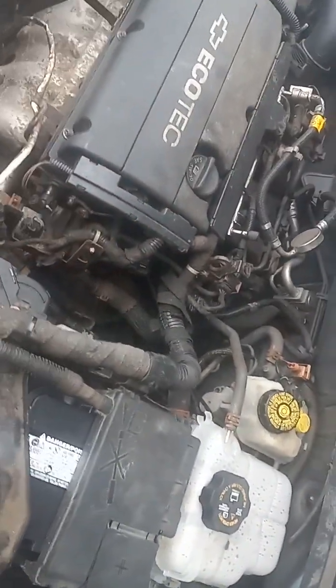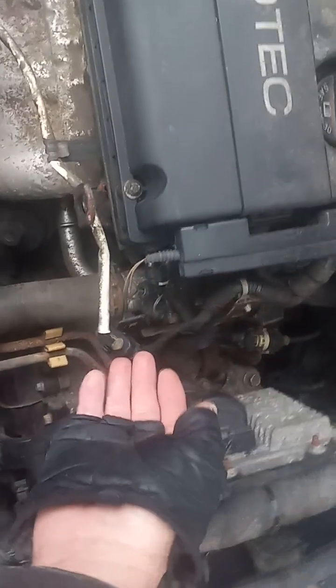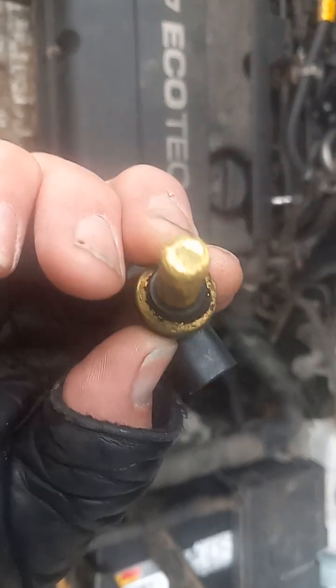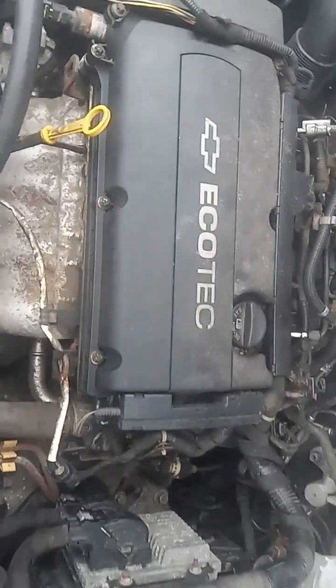They're all placed differently, but luckily this one was right on top of the engine, and this is a 2012. I have pulled up 2012 videos of people doing it and like I said, there's one down there where you pull the hose out, one over here, and then there's one way in the back where you're sticking your hand way in there. But this one's right on top. So if it's facing this way, you just pull it out, slide the new one back in, put the clip back on, and you're good to go — the light will shut right off.